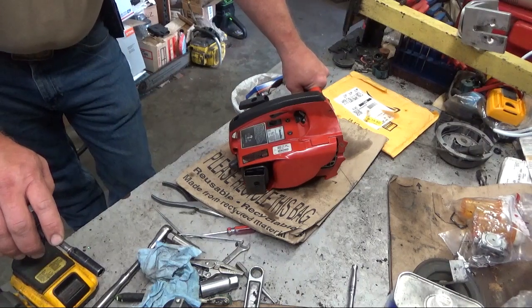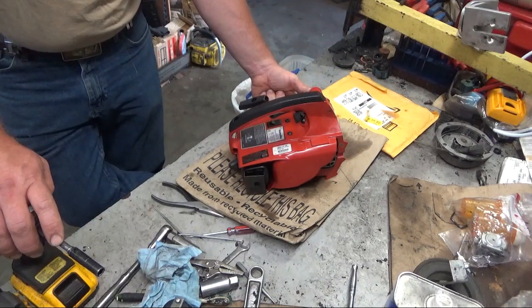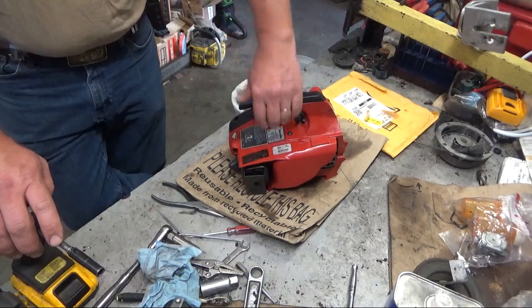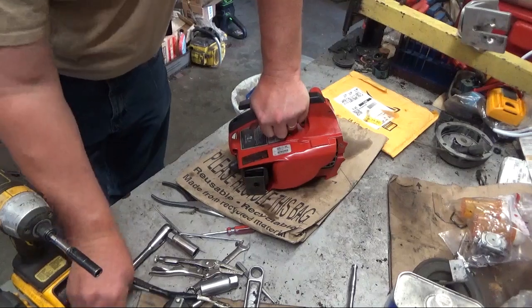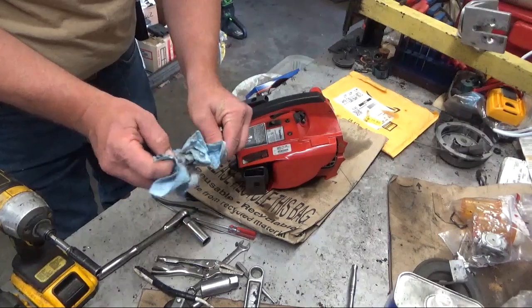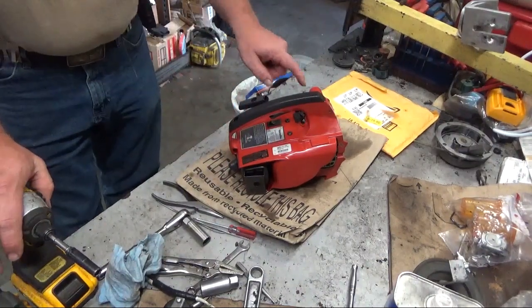We've seen on the Super Easies, especially, that gas or oil cap that has the duckbill valve in it. When that duckbill goes bad, even when the oil is at the bottom of the tank, somehow those things find a way to percolate the oil up and out that vent on the cap itself. I mean, it's counterintuitive. You wouldn't think it was possible, but I'm here to tell you I know for 100% certain fact that it is possible and does happen all the time. So we'll say it's the same thing.